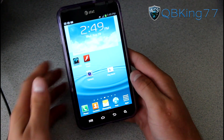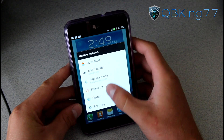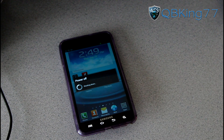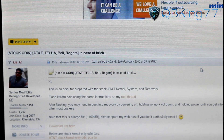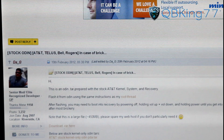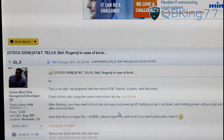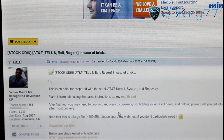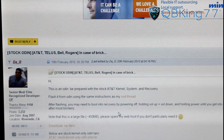Let's go ahead and unroot or unbrick this device. First of all, if your phone is bricked and you can't turn it on, that's fine. If it's not, go ahead and power off your device because we are going to need to have it shut down. I am rooted at the moment and do have a custom recovery as well. Once it's powering down, you're going to need to download some files. Click on the link in the description to get the stock TAR file. You're also going to need to make sure you have the drivers installed on your PC and download Odin as well.